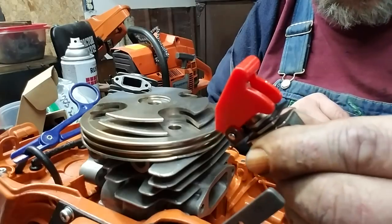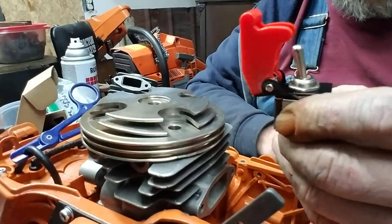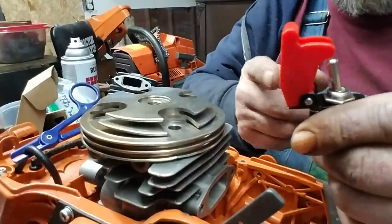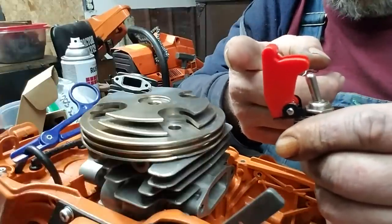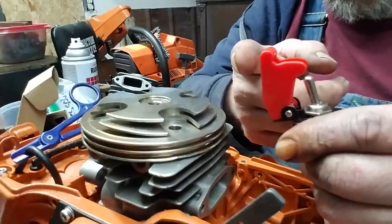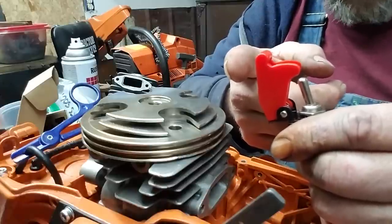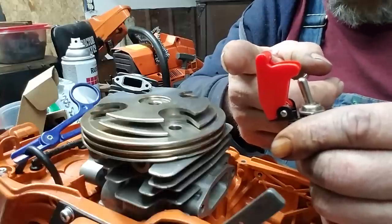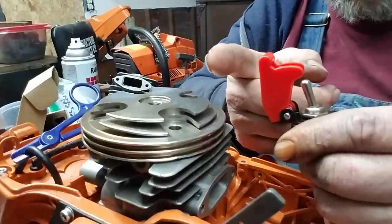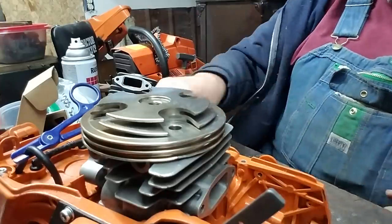We have a neat little kill switch — I showed it in the last video, it's a race car stop switch. It'll allow us to mount it so your hand is right on the operator handle with the switch right next to it. If you hang a reed, you can have a runaway because it'll actually suck the butterfly open. I've had bikes do it. I want to be able to shut it off right now without fumbling around for a switch.